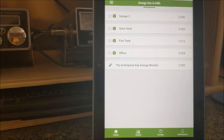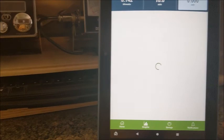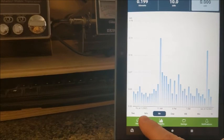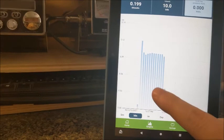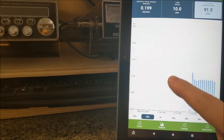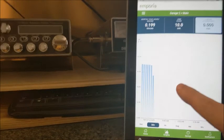The first thing I was concerned about was the old refrigerator out in the garage, so I started putting a plug on the garage. Looking at the garage right now — you can see it's running nothing at the moment. But you can see the minute-level view. Even on the minute, you can scan through and see your refrigerator cycling on and off. At the top as you scan across, it actually changes the time — so I go here where it's running 90 watts and it tells me 12:33. Then I go back to when it first kicked on at 12:22 and it's 116 watts. So you can go back through time and see how much your refrigerator is cycling on and how much it's cycling off.